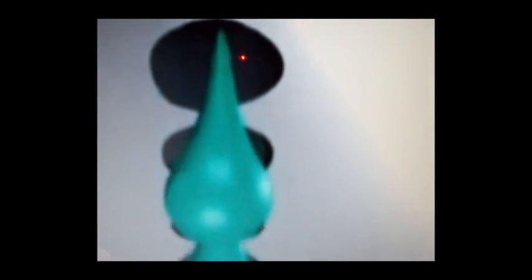Let's take a closer look at how the print head works. At the base of the print head, each ink drop is powered by a superheated vapor explosion, typically between 300 and 400 degrees Celsius, each occurring at one to two millionths of a second. The ink drop is rapidly expelled out of each chamber nozzle at a firing velocity of up to 20 meters per second.